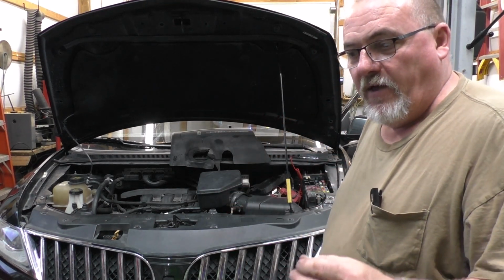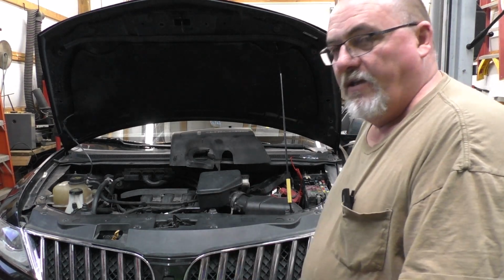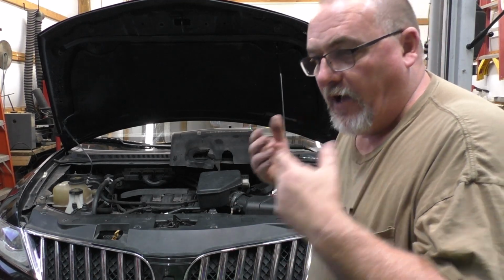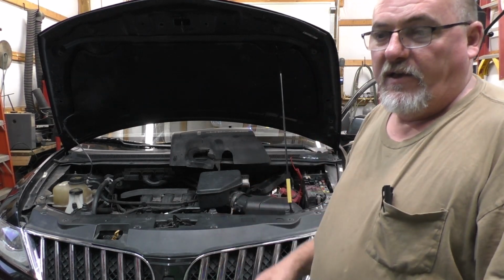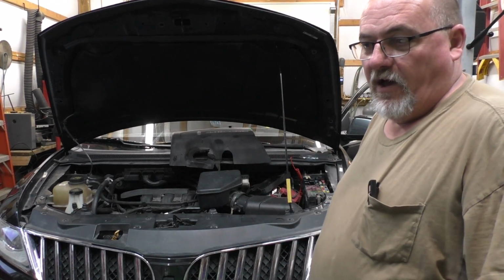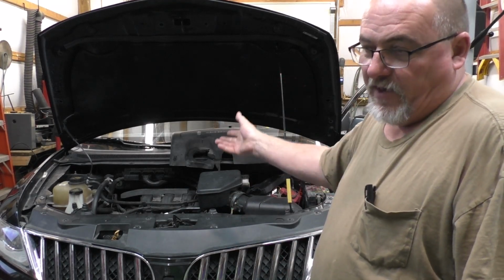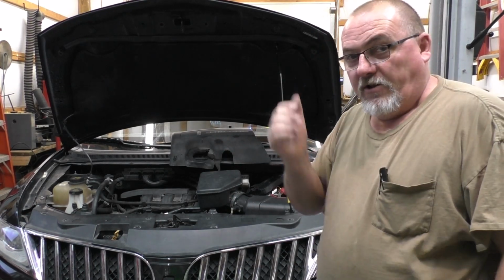And if the symptom returns, then the customer will know that, okay, now I'm gonna have to pay to get a proper diagnostic, and we're gonna have to do some current draw checks to see where things are going. We're gonna have to maybe even check some ohm values on the actuators. Just want to share this with you.